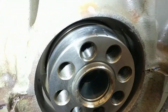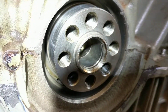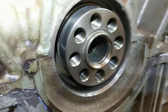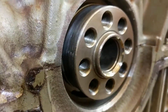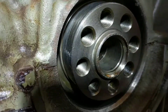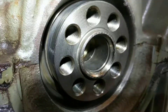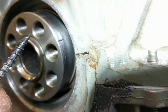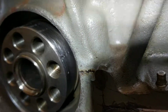What's unfortunate is that this common wood screw did quite a bit of damage to the end of the crankshaft — I count six places. On the left side there are a couple of scratch marks from when the screw was being turned in; it was a little too close to the crank and marred the side of it. On the right side there's a very tiny one right there and a slightly larger one from where it hit.